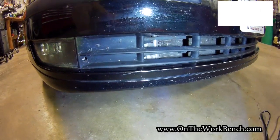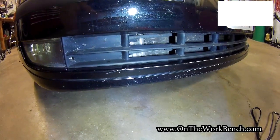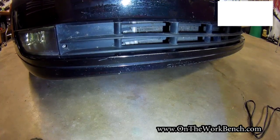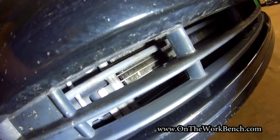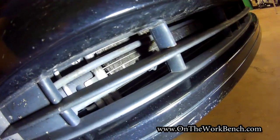Due to the ground clearance on this vehicle, it's not that easy to get underneath it. You can either put the car on jack stands — front stands work, all four is probably better for a better angle on the cooling system. Underneath, there's skirting that we'll need to remove with an 8mm socket to access the radiator and the petcock, which is covered from the bottom for aerodynamics.